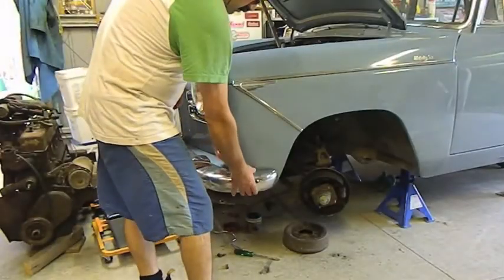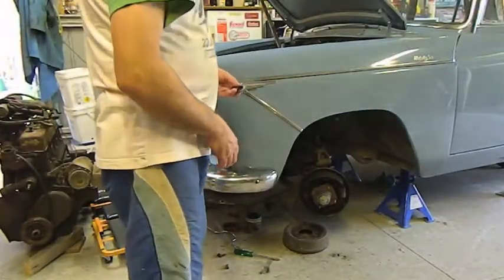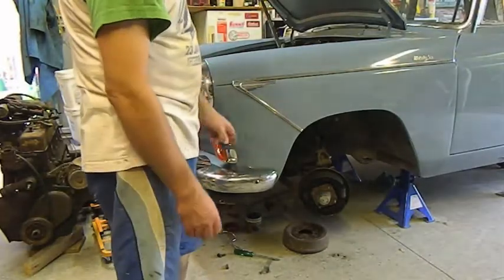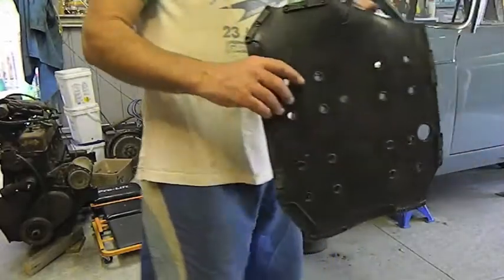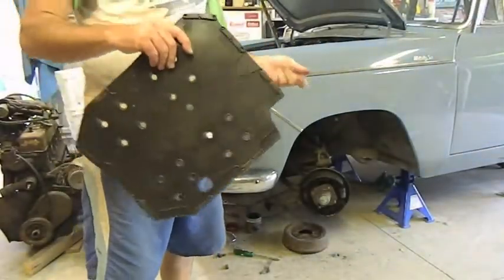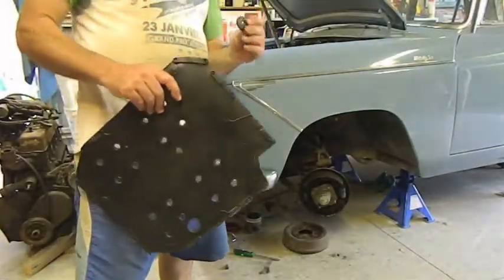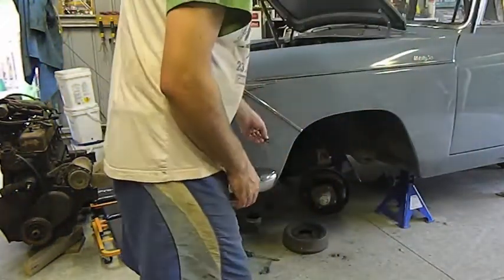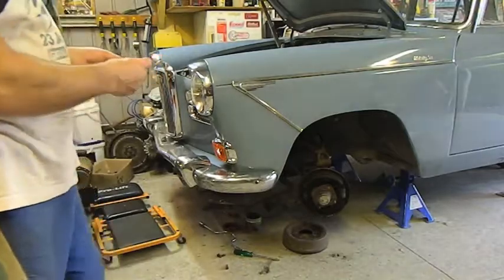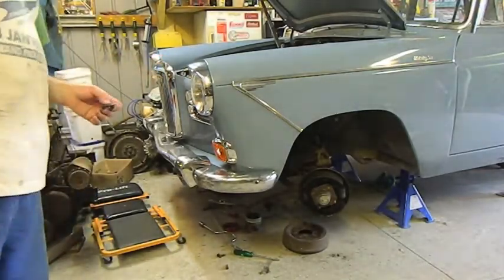Got to bolt the bumpers up to the side of the car. They've had some rubber, like tie tube or something, I don't know what it was, but I found this seat diaphragm off an MGB. I've just used a wad punch, punched out a hole and cut it out. It's lovely dense rubber. I might hang on to that. I'll stick it behind here so it doesn't scratch or do anything it shouldn't.